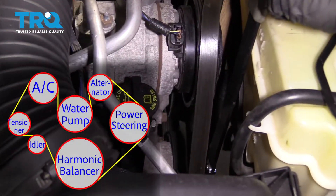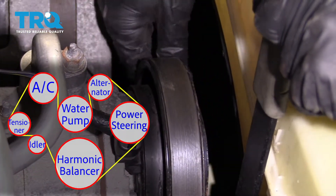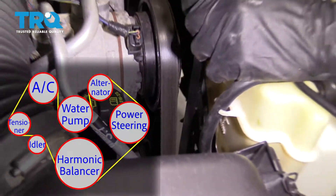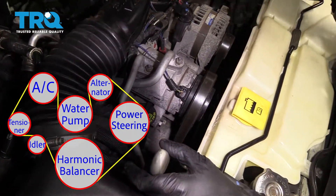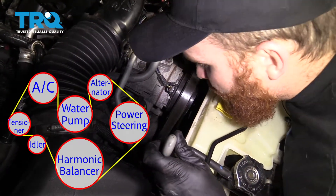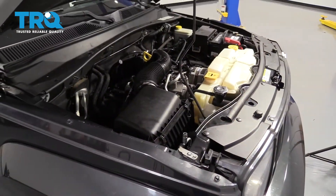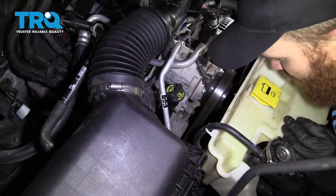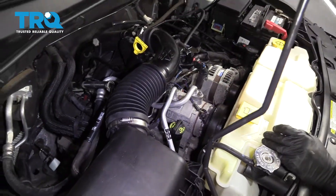We're just going to put this down over here. Getting the belt around all the pulleys the way it came off is sometimes a little difficult. I've got the belt on — we're going to double check and make sure it's around all the pulleys the exact way it came off, not hanging off any of the grooves. Make sure you get all of your tools out of here. Now we're going to start it up — we're only going to run it for a minute to double check that the belt's sitting on all the grooves as it should. Looks like I'm in the grooves on the tensioner down there. Perfect. Take her for a road test.